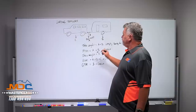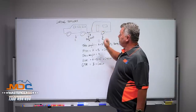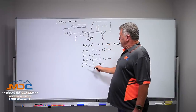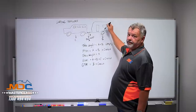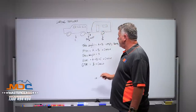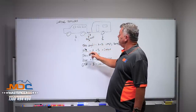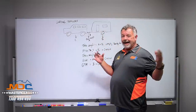Ball weight. Ball weight is the download on your tow bar from the draw bar — no jockey wheel down. That is just the dead weight on the tow bar. GTM is the axle load plus cargo; it doesn't factor in the tow ball weight. And GCM is your gross combined mass — that is the weight of your vehicle and the entire weight of the caravan and the ball weight as a combination.